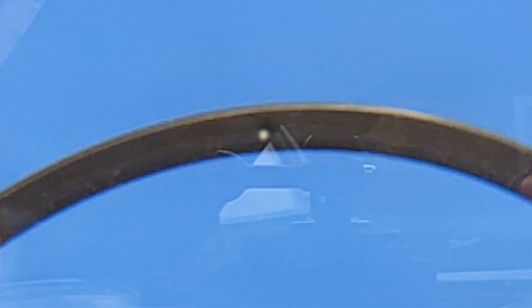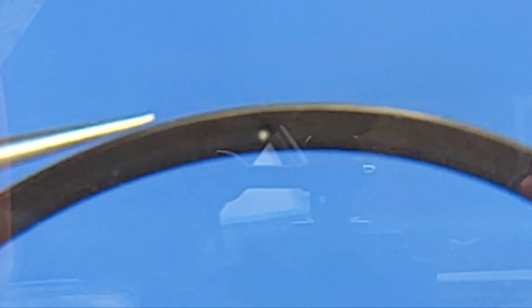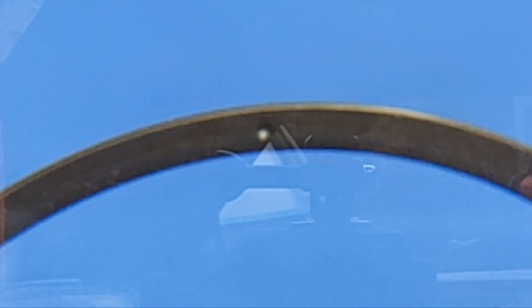There's a bump on this stabilizer ring and there are bumps on piston rings — we're going to concentrate on this one. It has a divot here; on a piston ring it's just a divot, but this divot is a bump on the other side. That bump, when it's on the piston in the normal running condition as it sits in the vehicle, is facing down. This is used for six-inch rods where the piston pin goes into the oil control ring land because the rod is longer and the piston is shorter — it's faster, it's lighter.